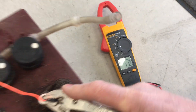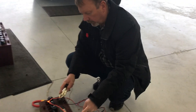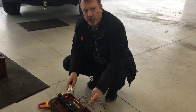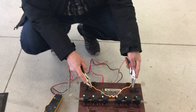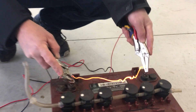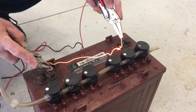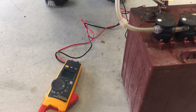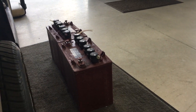That would indicate this battery is maybe not very good but still serviceable. Whereas the other battery that had a very high internal resistance — when we measured it showed 12 volts without a load, but once we shorted across it with the stainless wire, the wire wouldn't get hot at all and the battery voltage just drooped right down to about one volt. So this is a very expedient battery load tester — it works well and it revealed what the problem was with the golf cart battery.